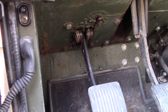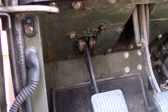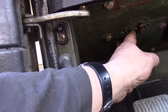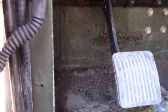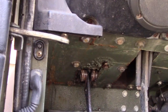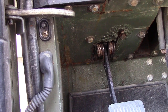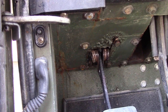Looking at the clutch pedal on my Defender 130, you can see that seal has been weeping for quite a while. You can see the paint's all lifted off and where it's been running down. The paint just comes off - I'll have to repaint that again. It just peels off when they've got brake fluid on it, it's terrible stuff. Looks like we're going to have to change this cylinder.